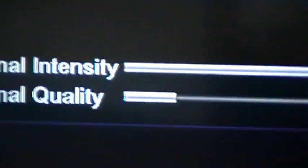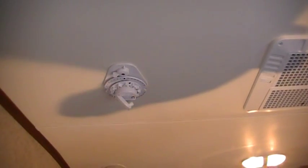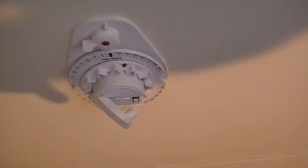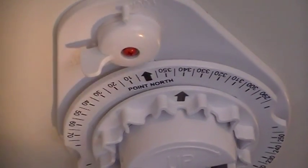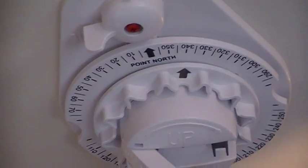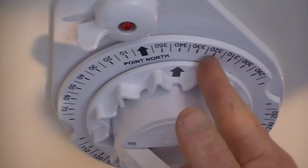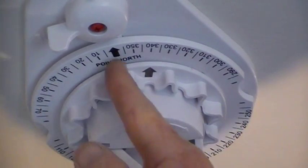If we go back to our interior controls — just to reiterate, we've wound it right up and back two turns to set the elevation to around about 42 degrees. That is if your RV is on a level playing field. If you're on a slight angle you might want to try a quarter turn up or quarter turn back. Freeview New Zealand is located around about 320 degrees from north.